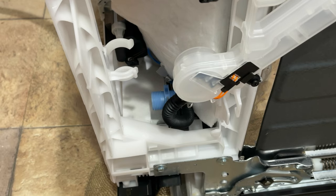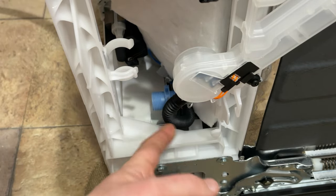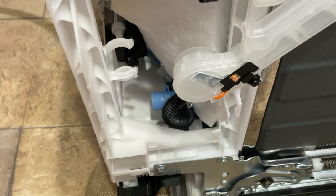After you've done all that, in whatever order you choose, you can install your water inlet line. This is where the water comes into the dishwasher. Typically the inlet line will be blue, so that's how you know what it is. It usually has a little hose going into this apparatus and into the dishwasher, and then the drain will come out on the other side. They're usually right next to each other, usually on the left side of the dishwasher as you're looking at it from the front.